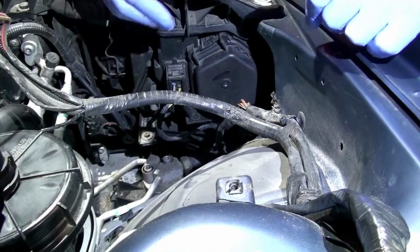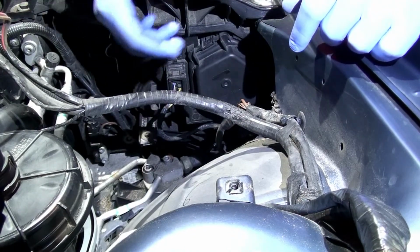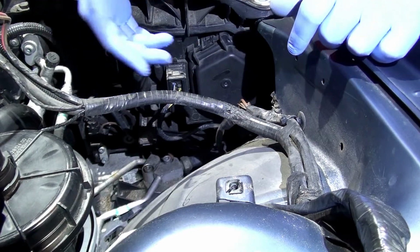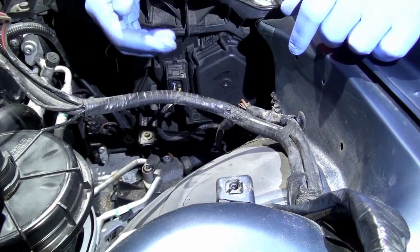You can see that. So just make sure your bulb's in straight, because the last thing you'd want to do is have that bulb rub up against the little cap covers on the inside, blow your bulb early, or your headlights not look right because the bulbs themselves are at a wrong angle pointing down the road.